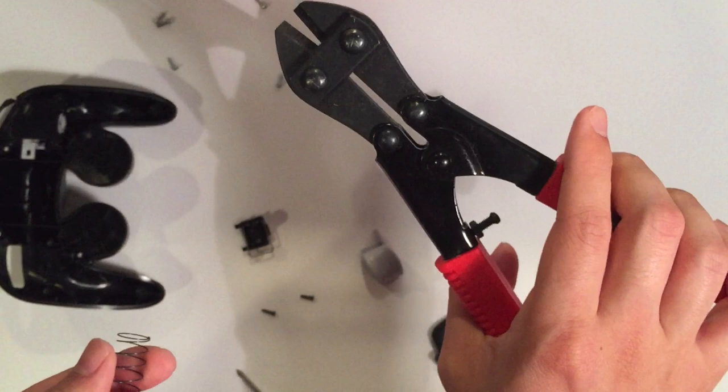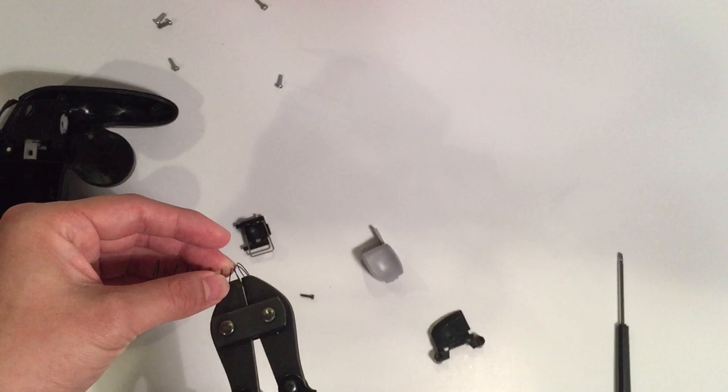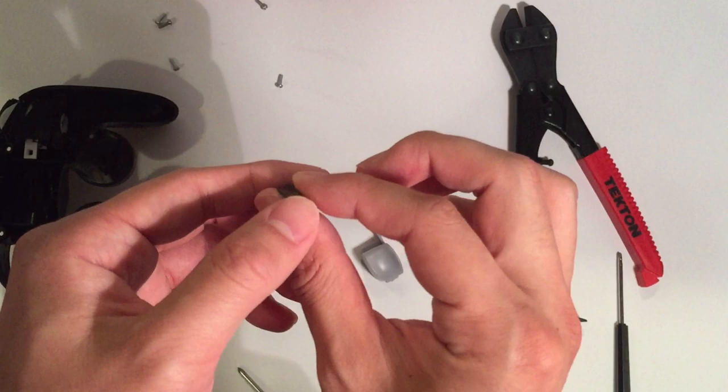Using our tool, we start from the spiral and I usually go down to about here. You just insert the spring into the tool, press down, and there you have it. Make sure to take your time and have a clean cut throughout, and make sure that both sides are even — you definitely don't want your shoulder buttons to have different feels.